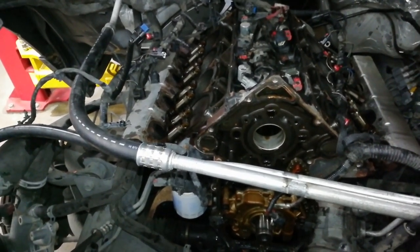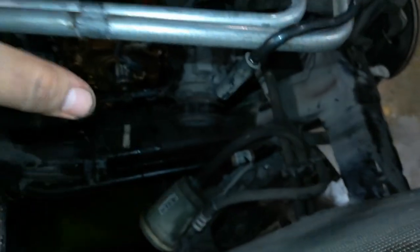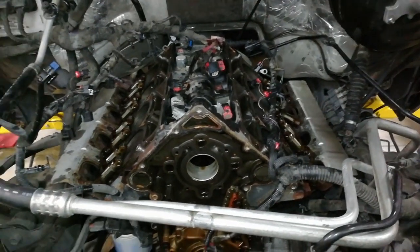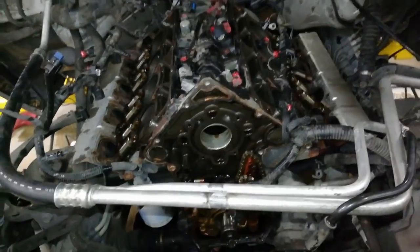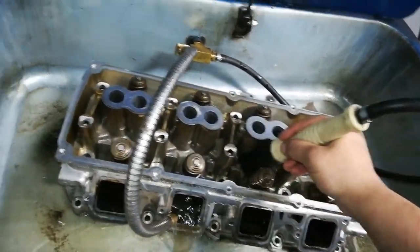A few tips: you don't have to remove the exhaust manifolds all the way - just unbolt them from the heads and let them lay there. This big bracket down here has the power steering pump and the alternator bolted to it - I just took it off and let it hang, so I didn't have to undo power steering lines or take off the alternator. The AC compressor I just unbolted and moved aside without undoing the lines. To get to the intake manifold bolts, take off the liners and you can access them through the wheel well pretty easily. Now I'm going to clean up the heads, prep the surfaces, and put it back together - I'm sure it's going to run just fine.